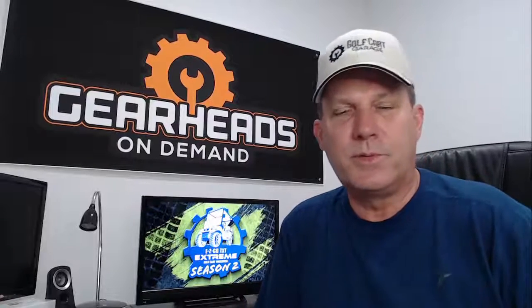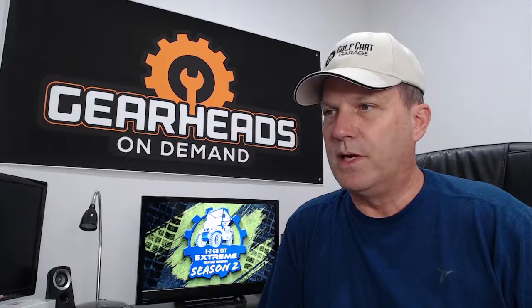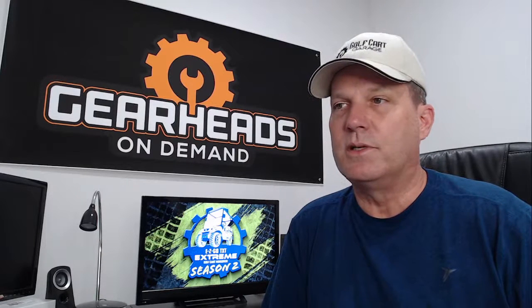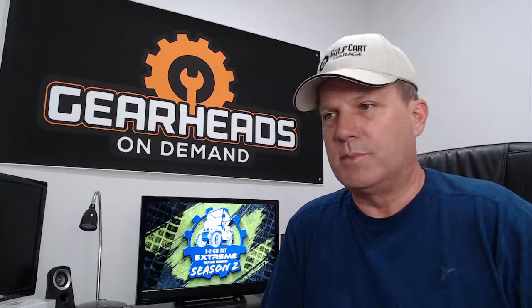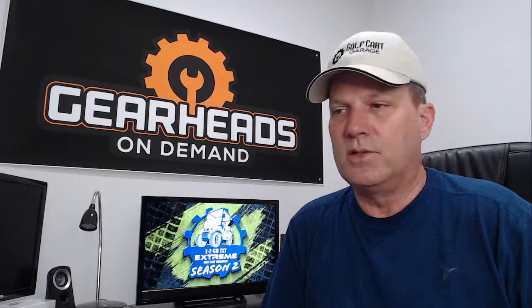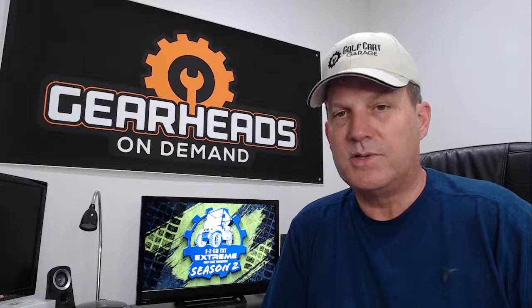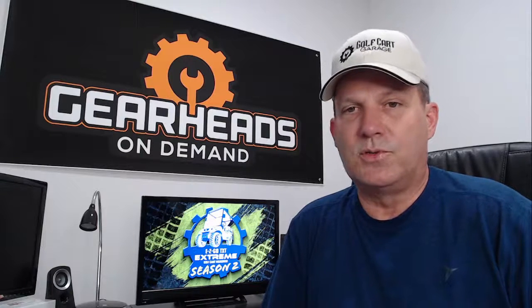I remember speaking with Stephen this past week. We had a long conversation about his dilemma, and we have come to the conclusion that he possibly had gotten a bad voltage regulator. He had gotten some very inexpensive stuff from Amazon, and a lot of times you get what you pay for. So he's going to try another voltage regulator, because most of the charging problems that I have come across in my experience were the voltage regulator. It wasn't the starter generator at all. It was just the voltage regulator.